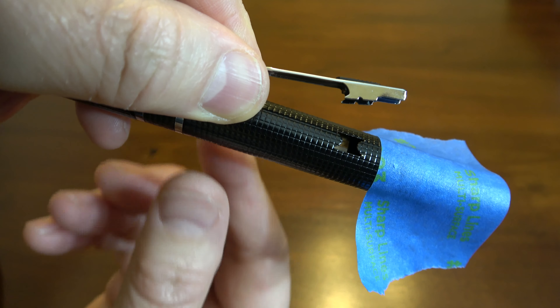Before I do that, I want to show you a little bit more about this plastic lens cover. It's made up of two pieces and it's basically a friction hold. So if you pop your clip off, those two plastic pieces might actually pop out. When we are squeezing this end right here, we're basically clamping this together so that these two sides squeeze tighter against the lens cover piece.